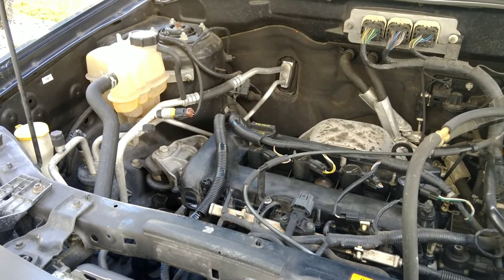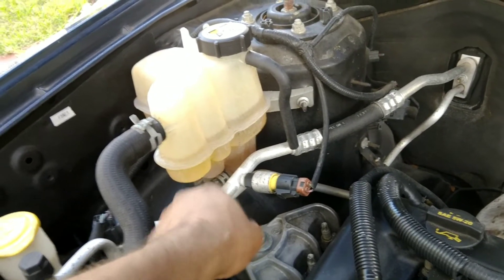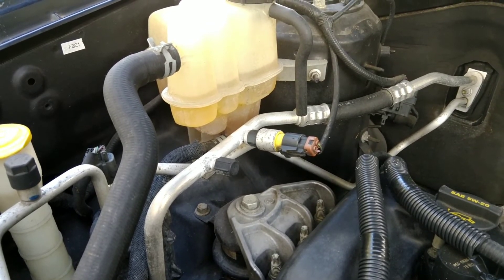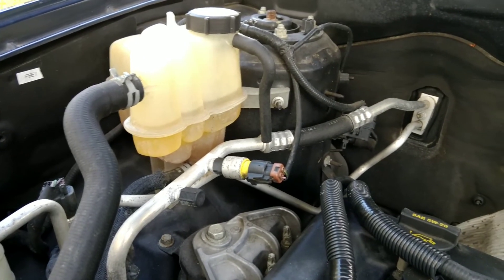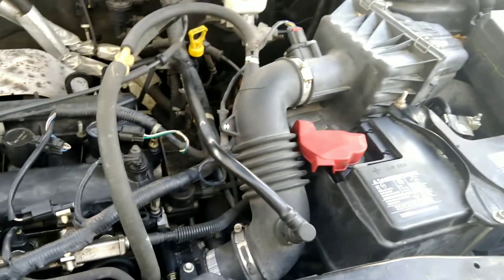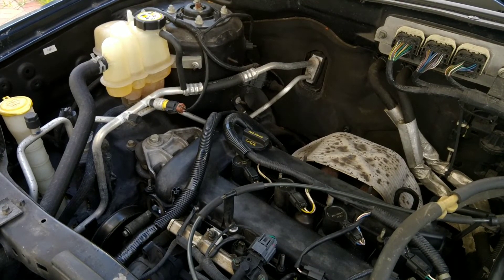It's been almost one week since we replaced the coolant. I did have to refill this about twice as the distilled water evaporated and to balance out the mix. In hindsight, instead of 50/50 I should have gone with maybe 60 or 70 percent coolant and 30 percent distilled water. But it all worked out. Again, you should always get all work done by a licensed mechanic — this video is for entertainment purposes only and basically for my memories of what mistakes I made.